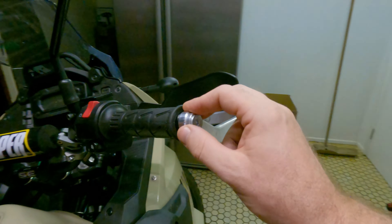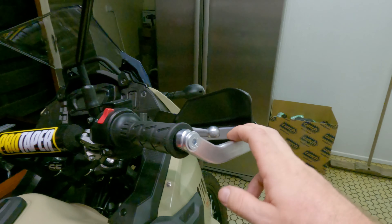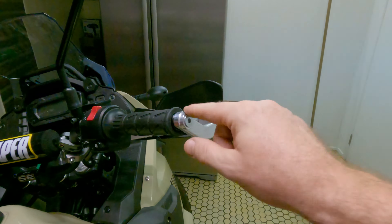There's a thunderstorm outside — that's why I'm not doing it outside and why lighting isn't great. Just loosen it off a bit if you need to so you don't scratch your bars. Put that Allen key in there and tighten this up a bit, same for the front one. Just make sure it's braced a bit higher so it covers where you want it to actually protect, which is generally your hands and your brake and clutch levers. If you've got these ATV high bars, that is probably the best spot to do it — just on the inside of the brace there.